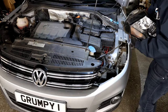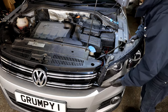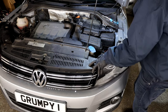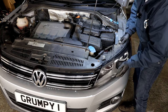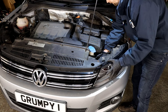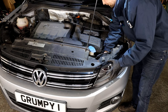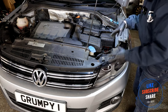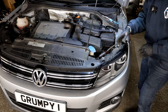To fit it back in, make sure you don't scratch the bodywork or the headlight unit. It's nice and easy — locate it in there, pull the plastic back first, get the cable on top of it. Don't forget to plug it in at this point — it clicked. And now you have to fit everything back together, and don't forget to put the metal plate back on there.